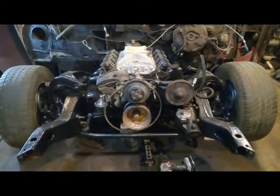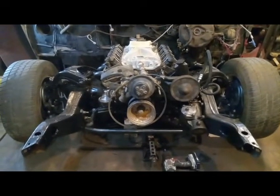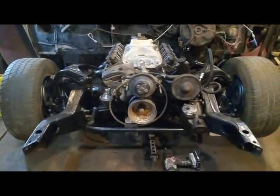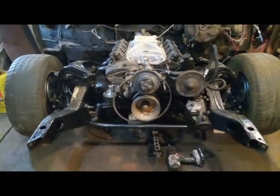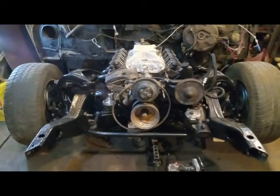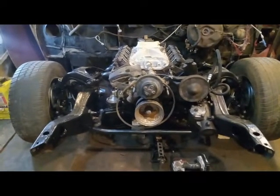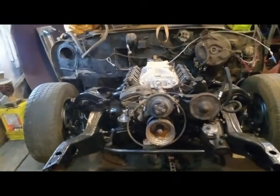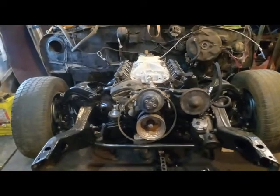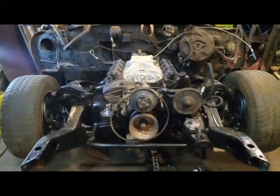The front suspension is completely rebuilt with a new 1 1/4 inch sway bar, new ball joints, long ball joints on top. It's got different steering knuckles for correcting bump steer, has lowering springs. It's been adjusted for some positive caster to make it handle. This car is meant to be for both street driving and autocross. I might take it to the drag strip, I don't know.